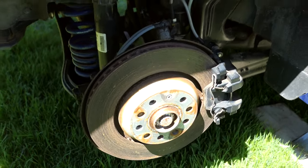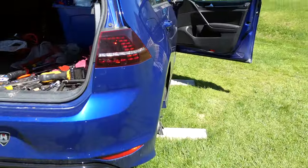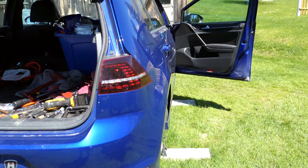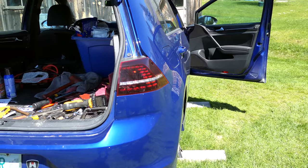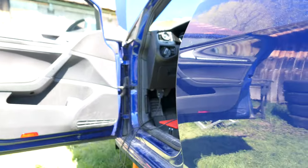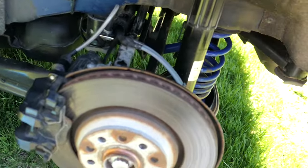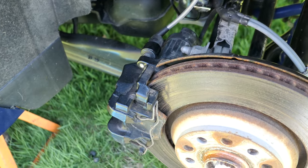Right now the car is off. The emergency parking brake is disengaged, but it's not going to work out for you unless you start with step one: load up VCDS, plug in, and do this. Make sure your battery is fully charged before you do this. We're going to walk through that now — I'll post the instructions at the link below. We have released the rear brake caliper parking brake on both sides via VCDS. So that's all done now. Now we're going to try to get everything off.